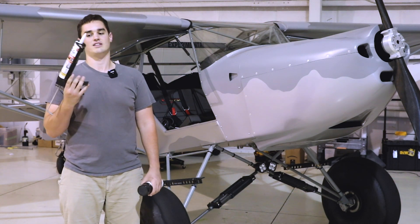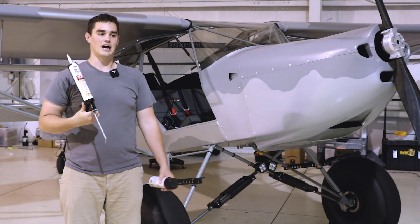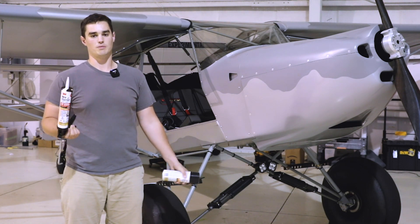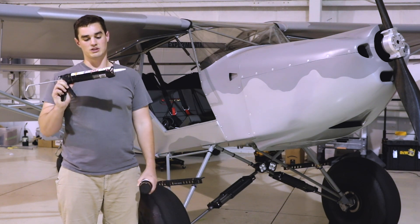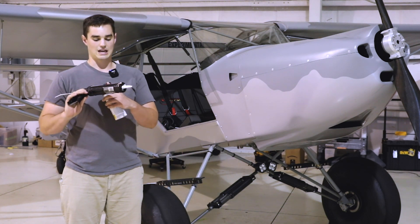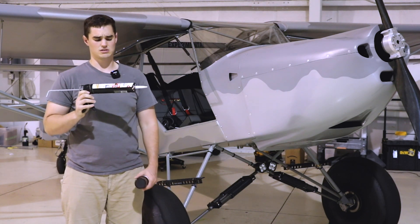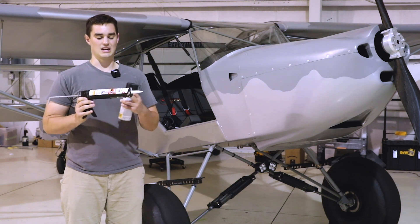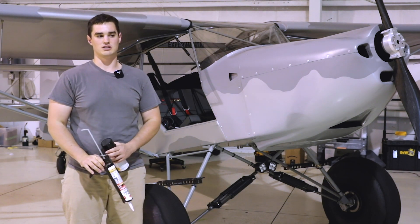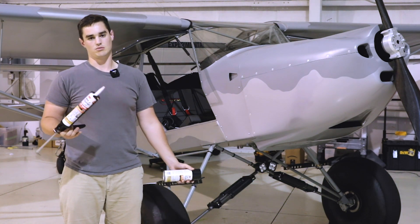The reason I'm holding this caulk gun is because I didn't have any fire barrier sealant — the stuff Kitfox sent me was about three years old and didn't have the fireproof rating on it. You don't necessarily need something fireproof-rated to seal your firewall; it's mostly to keep fumes, carbon monoxide, and smoke out. I went with the 3M fire barrier sealant — you can get it at the hardware store, it's tacky, rated up to 1,000°F for flashing and around 500°F continuous. It's nasty to work with, but it has flex to it so I'm not worried about vibration, and the whole tube was about $20 at Home Depot.